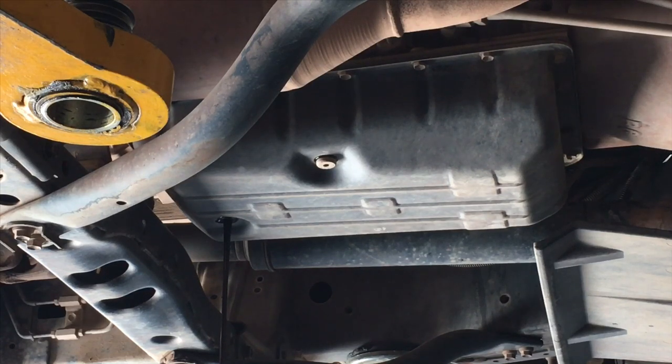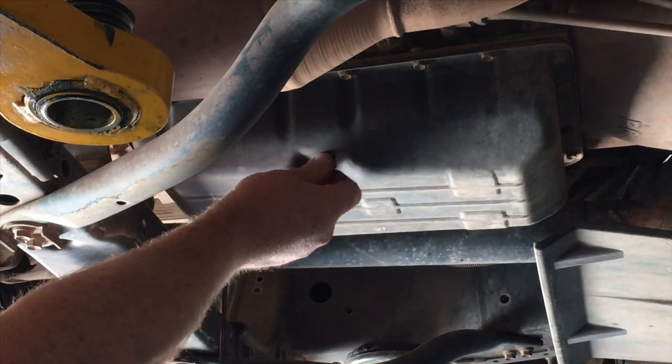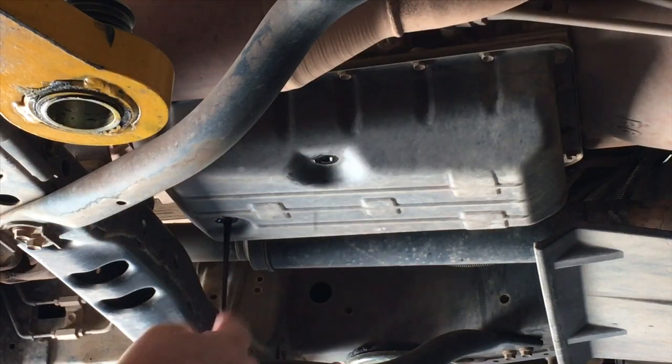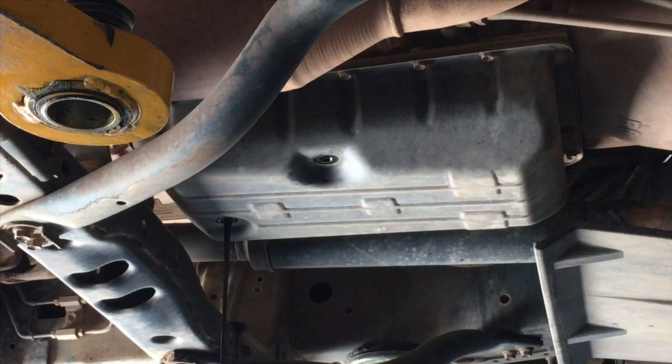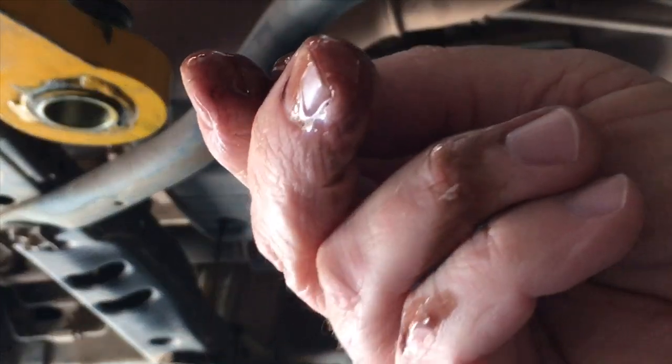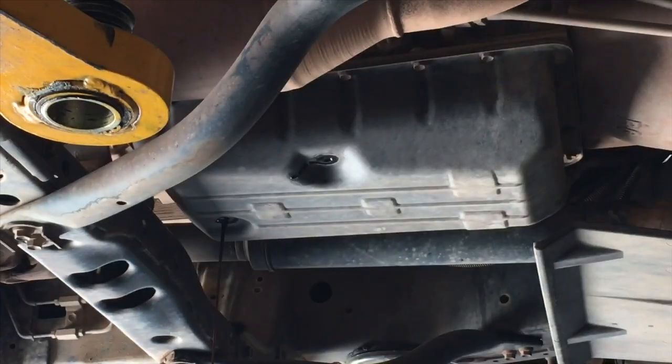Watching the oil drain — safe to say it's below the check level, so we're going to take the check plug out also, being careful not to lose the couple of little washers there. Same washers on the drain plug and the check plug. There's a little bit of red colour in this — it's not filthy black stinking oil, it's just brown, a bit discoloured, not too bad. As it gets down to a thinner stream I can see the red in it, which sort of tells me it's not in bad condition.